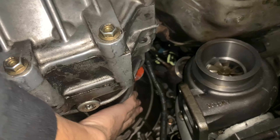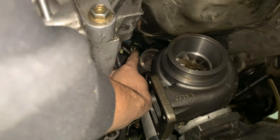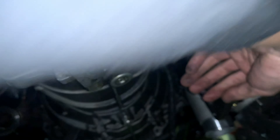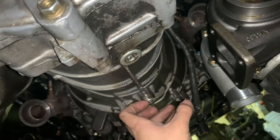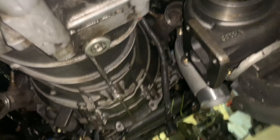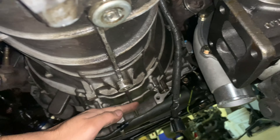We're down under the car — bank one and bank two, both V-bands. We want the turbo as high as possible. The hitting points are the car's frame and the transmission, so we need enough space for the piping to get through. We'll tuck the piping up to have room for the turbo, the V-band before the T4 flange, then flex pipe coming around. Bank two will come along the transmission, loop downward, and transition into the pipe from bank one, meeting at the V-band before the turbo.